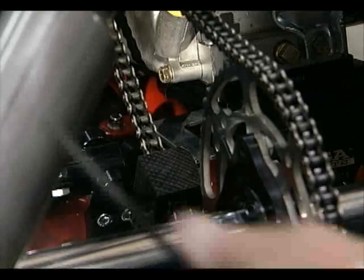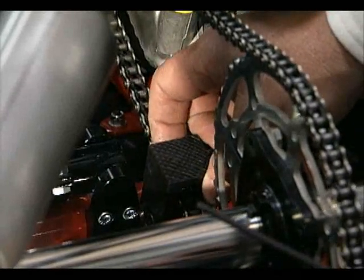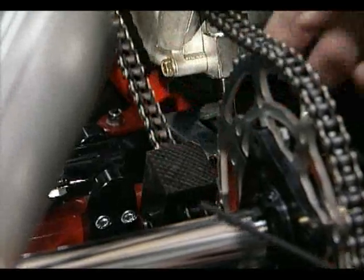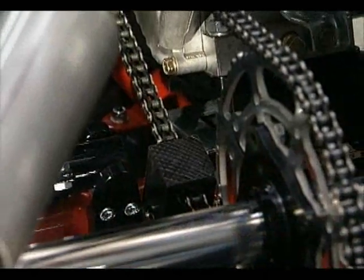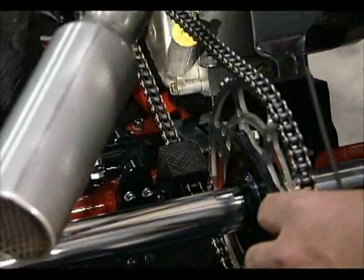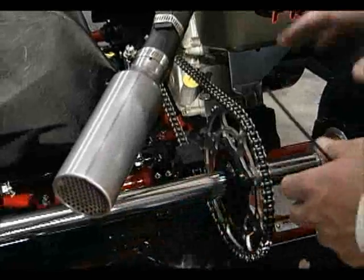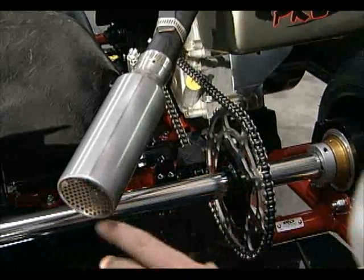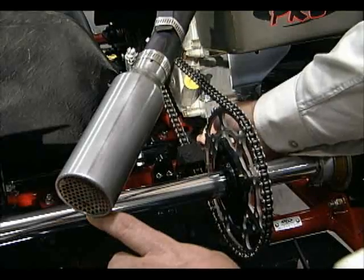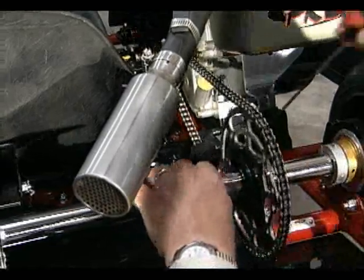We've already got the motor mount and everything placed on the cart just like normal. You want to run your chain through your plastic block, get everything assembled just like normal — your clutch is on just like you're going to race it, everything the way you're going to go to the track, the gear the way you're going to do it. Everything's loose. We're going to go through how to properly align all this so you won't have trouble at the track. What I do first, with this still loose, is I just eyeball the chain right quick — I eyeball the rear gear to the front gear. It doesn't have to be perfect, just get it close for now.